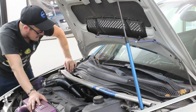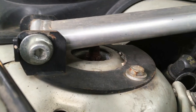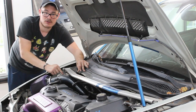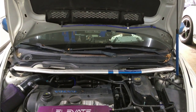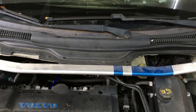Now, some people will debate that having a bar that's bolted on the end means it can actually flex a little bit. While that is true, these do have some offset washers that help hold it in place. Overall, I think this is one of the better options on the market because it is removable, and when you do need to remove it, you don't actually have to unbolt it from the strut towers. There are plenty of other strut tower brace options available for these cars, and most of them probably should give you a decent improvement. I just listed the reasons why I prefer the Euro Sport Tuning brace. One of the other reasons I really appreciate this bar is because of its symmetrical design — a lot of aftermarket braces don't have a symmetrical design, and that kind of annoys me.